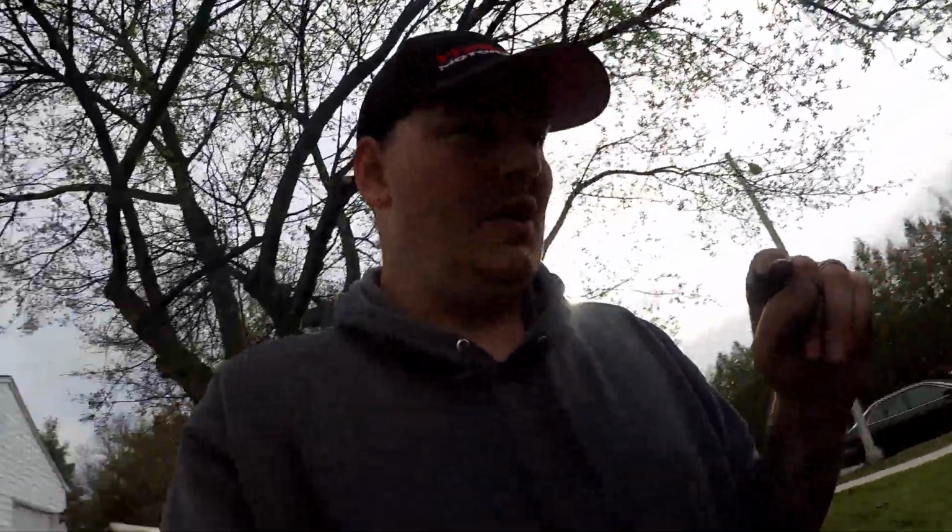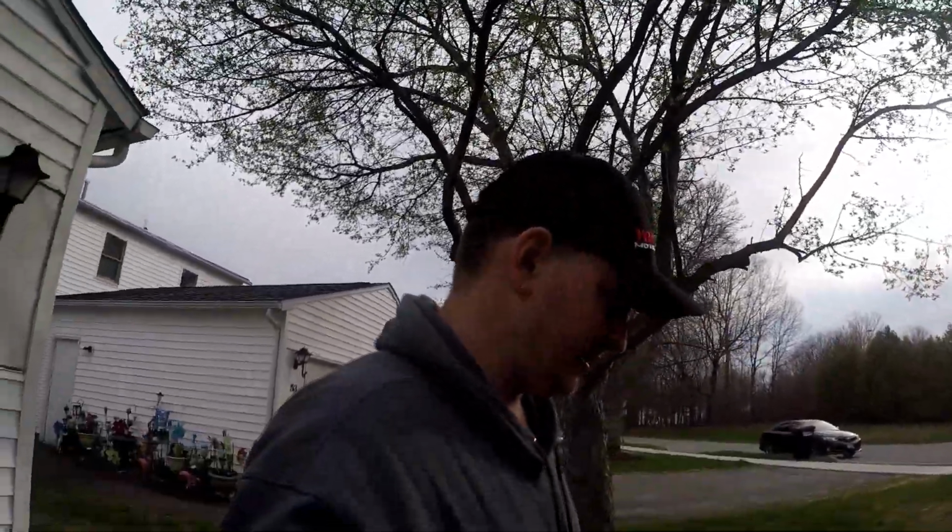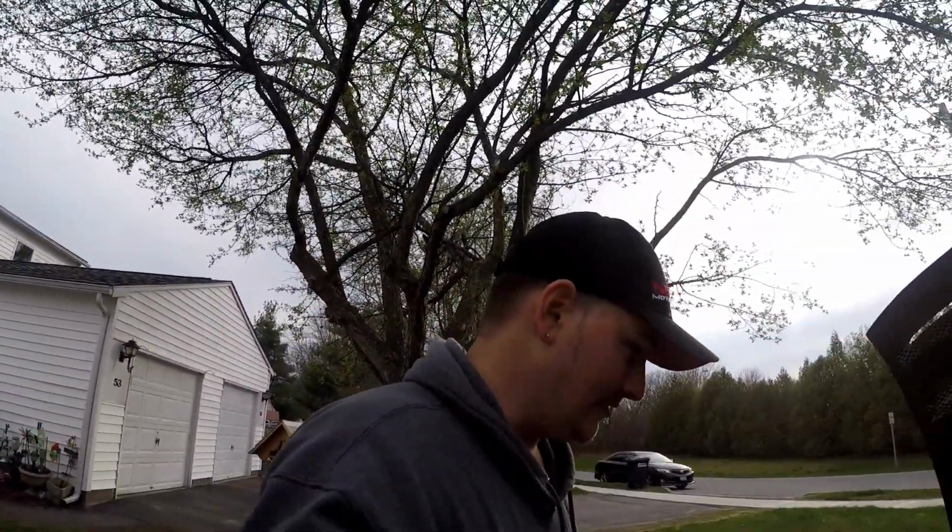So tomorrow she'll be back together, but as you'll see in the video, valves are all adjusted, and I went 8 in the front, 10 in the back. So 8 intake, 10 on that exhaust. New gasket, so we ain't going to be leaking no oil, with the spark plug tubes, valve cover gasket. What else is new? Made sure all the spark plugs were all cleaned up and everything when I put it back together, so hoping for a good outcome. We'll see what happens.